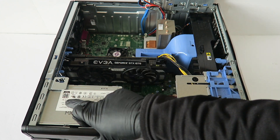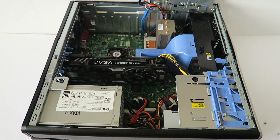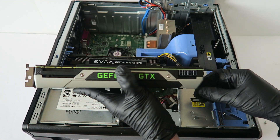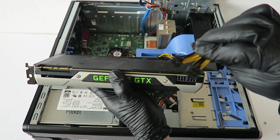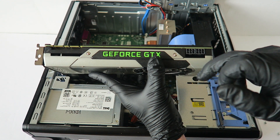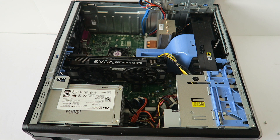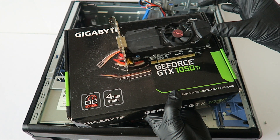You don't have to upgrade the power supply — it's 80 Plus Silver, it's really good and very powerful. If you have a GTX 1070, you can also use a GTX 970 — it will also fit, you just have to get a 6-pin to dual 6-pin cable, they sell this online. I tested both video cards on the system already. This is a GeForce GTX 970 Founder's Edition — it's pretty nice. Or you can use a GeForce GTX 1050 Ti — this is a little slower than the GTX 970 but has 4GB of RAM, so it works too.